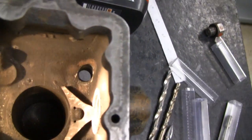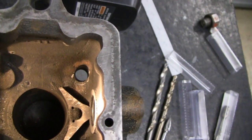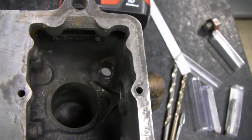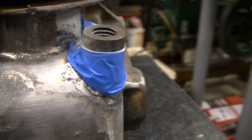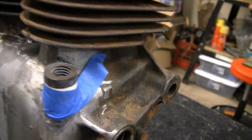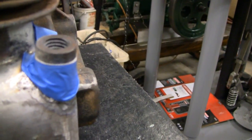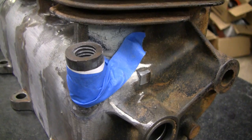Alright, I was able to widen that hole down there — came out pretty good. I didn't touch a thread either. I was going to set you up so you could watch me do it, but there just wasn't enough room with the light, the tripod, the camera, my hands, and the grinder. Had to do it without you. Now let's try and shorten that spout. I wrapped a piece of paper around there trying to get it as level as possible because that is a machine surface and it has to match up with the bottom of the bolt to create a seal. A lot of the old-timers will know what I was trying to do with that piece of paper — trying to get it round. I think it's a little tapered and not perfectly round, but I'll probably wind up having to play with it with a file and do it by hand anyway.